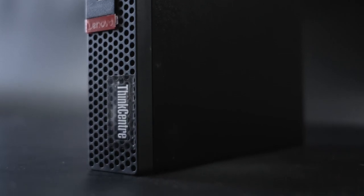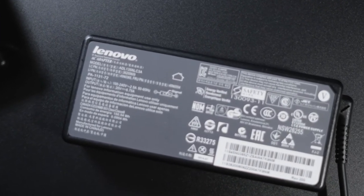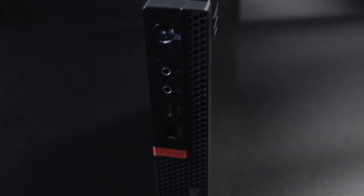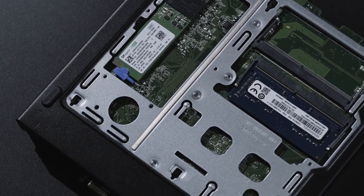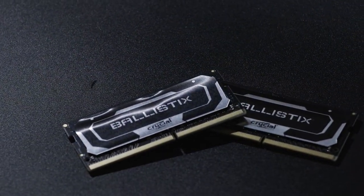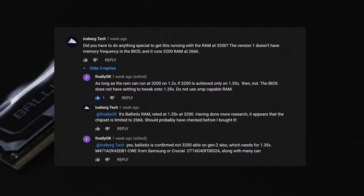But yes — if none of these caveats put you off, this is an excellent micro PC and well worth the money I paid. It's dead silent at idle and surprisingly quiet even under heavy load. The 135W power supply is needed to get the kind of performance I'm seeing here, but you should exercise caution and make sure you're getting an official PSU that matches the voltage of the original, as this may invalidate any warranty you have. One of these PSUs should set you back between £35 and £50, and if you get the 8GB model you'll also be needing a second stick of DDR4-2666 for another £20 to £30. Don't do what I did and waste £70 on a 3200 kit — it won't help. Someone mentioned that a kit hitting 3200 at 1.2 volts could work, but I've got no way of validating this.